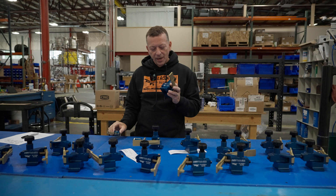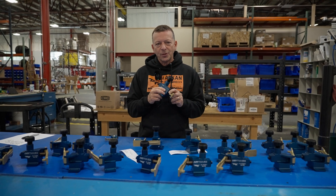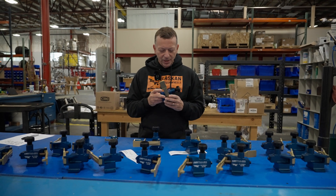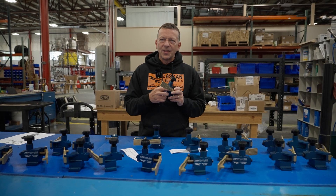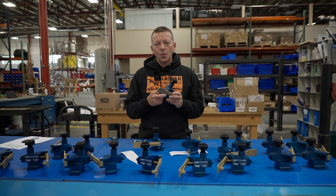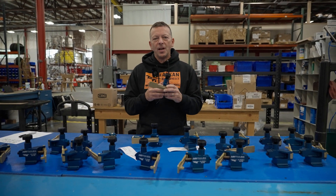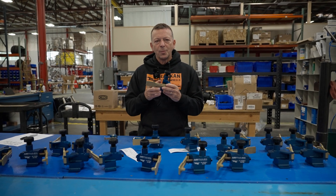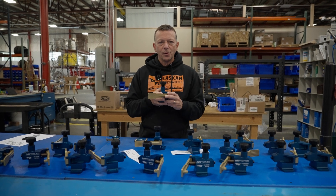Also the least expensive one on the market. The big design change in our brake master cylinder is that we have redesigned it with a smaller diameter piston, and what that does is it creates higher hydraulic force in the brake master cylinder with lower heel force. That travel allows you to get much more of a progressive feel when you're braking. The old Scott master brake cylinder tended to be sort of an on-off affair. This one, you get a lot more progressive feel as you're applying it in the aircraft.